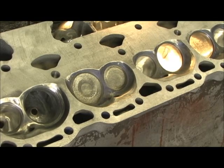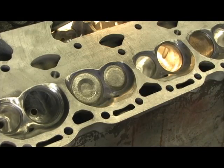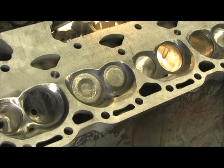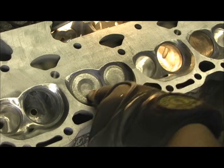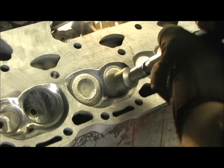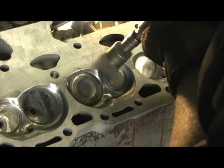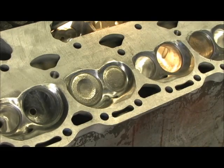One of the things I wanted to keep in mind here, as you can see, I've got a couple of dummy valves in there now. Valve job and all that stuff's done, but where I epoxied the heads, put the tubes in and everything, one thing I like to do is just take a wire brush and just kind of roll over the combustion chamber with a little bit smaller valve. This is actually like a 1.8 valve and a 1.450, just a little bit where it's barely covering the seat, and I go in here and just kind of touch off on it.